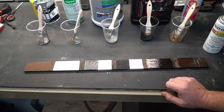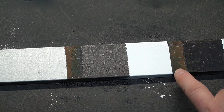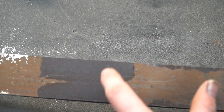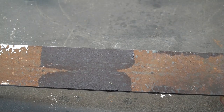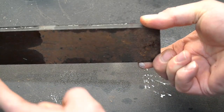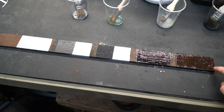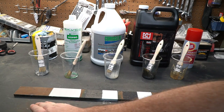I want to point out something interesting I noticed when I took off the tape between each patch. If you look at the area where we placed the Ospho, you can see it creeped quite a bit underneath the tape on each side — that's really good because you want something that creeps so it can work itself under pieces of rust. The New Hampshire oil creeped a little under the tape, but flip it over and you can see it really creeped down the bottom. New Hampshire oil is actually great for undercoating a vehicle because it works itself into all those little nooks and crannies. The Fluid Film did creep a bit under the tape and down the sides, but nothing like the New Hampshire oil. The New Hampshire oil has stayed oily and tacky, while the Fluid Film dries a little and gets more waxy over time. We're coming back in springtime with a video to see how these products fared.